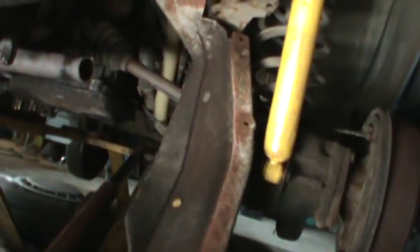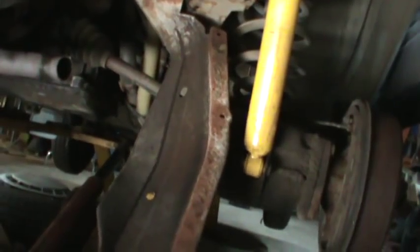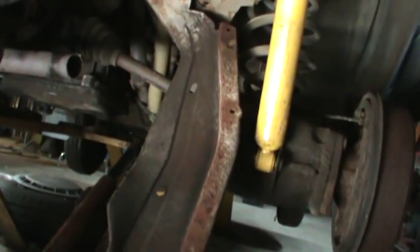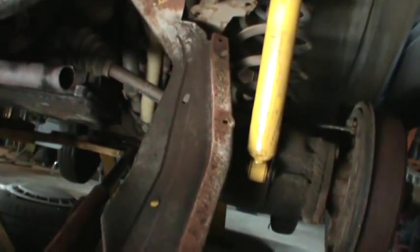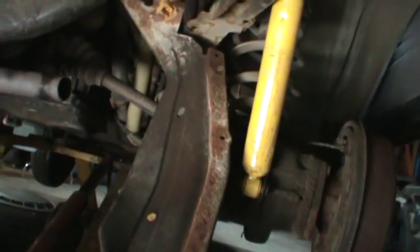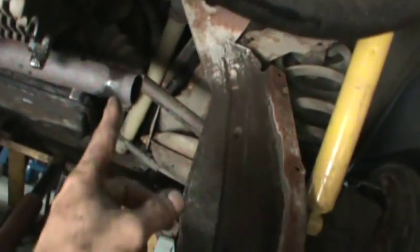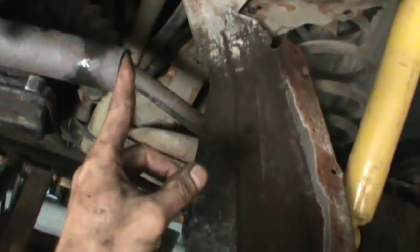On the bottom there were the outside heat shields — this one's still hanging on — pulled that down out of the way, same thing on the other side. Then just unbolted the exhaust off of it all the way around. That got to be a little bit of a pain because on the heads one side has studs and the other side has bolts. Of course the bolts don't want to come out, so they actually ended up slicing this one right here.